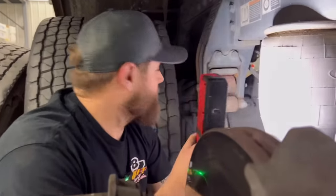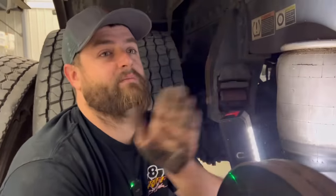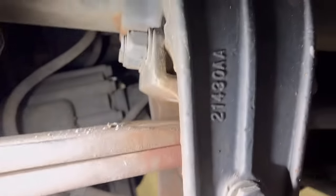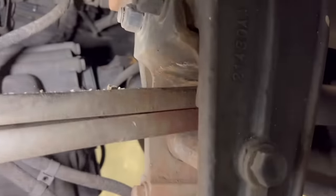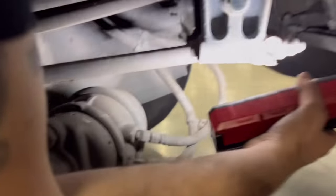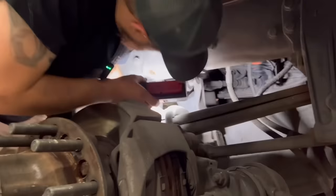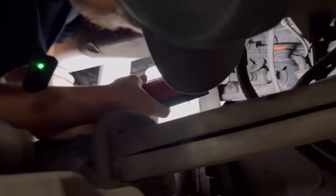There's a ton of force on those track bars with this thing going side to side, especially on the front axle which is always being manipulated since the front and rear are the pivoting points. Looking at the spring bushings right here — those actually look okay, not too bad. But definitely the track bars need to be replaced, and they're not too hard to get to.